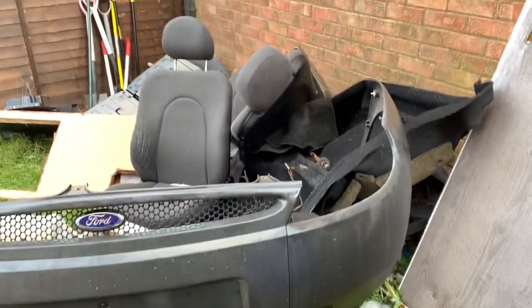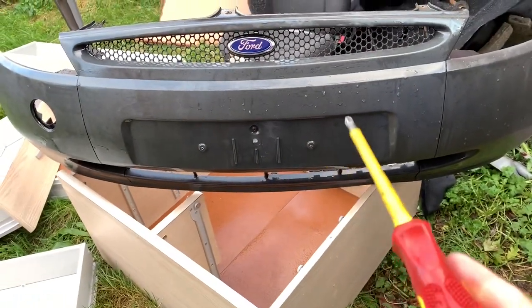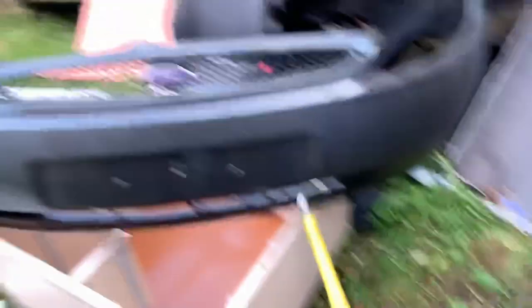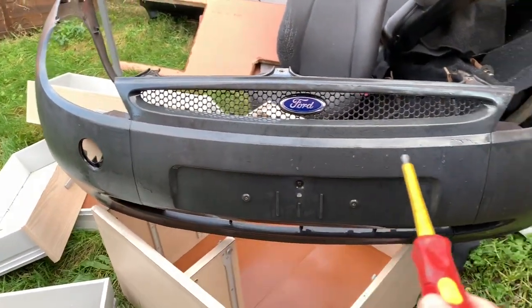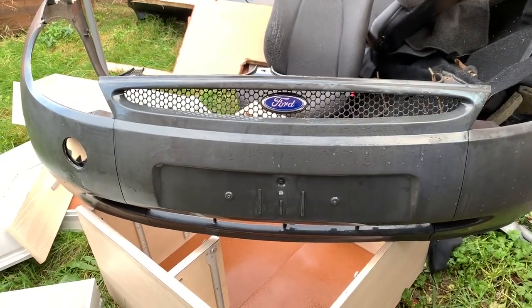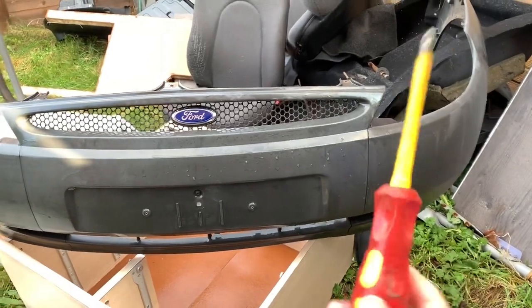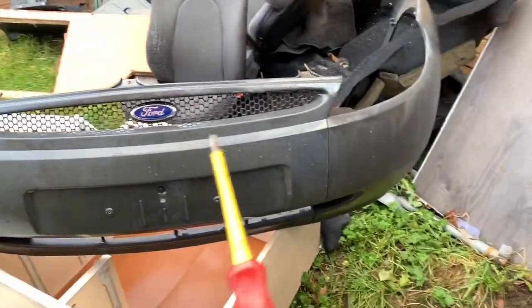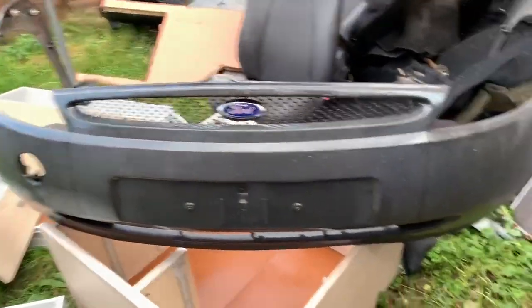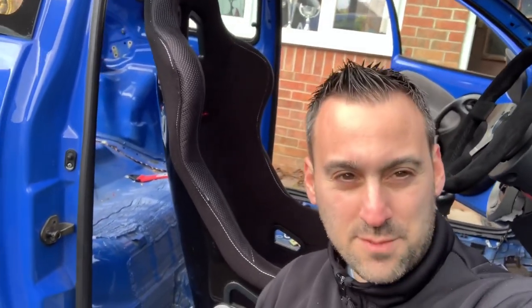Now I'm cleaning the front and rear bumper — yes, it does look like a scrap heap. We're going to clean it with warm water to remove the dirt and debris, then use proper shampoo, clean it again, and dry it. I'm taping off parts of the car and we're going to spray it with a satin black rattle can. Rather than leaving it grey and ugly, it's going to be a nice satin black that'll really make the car pop.